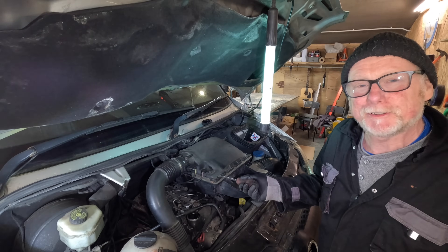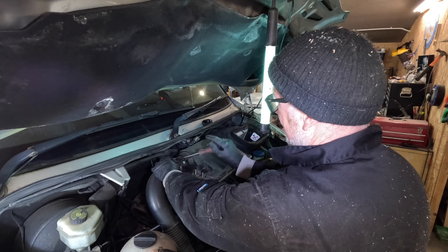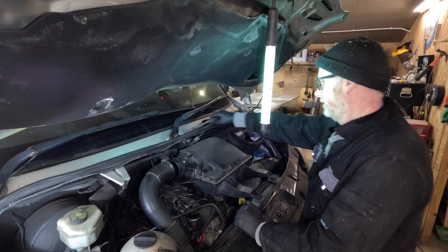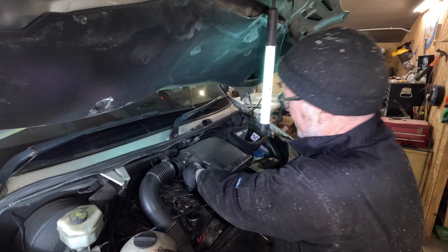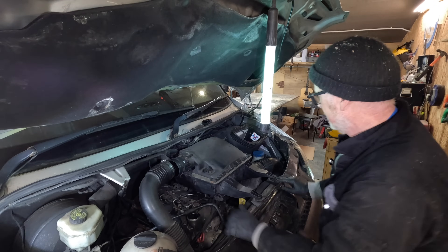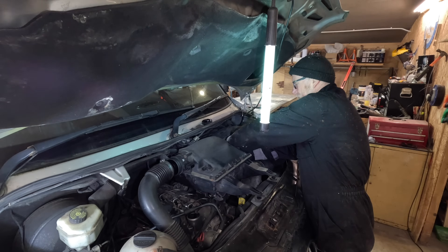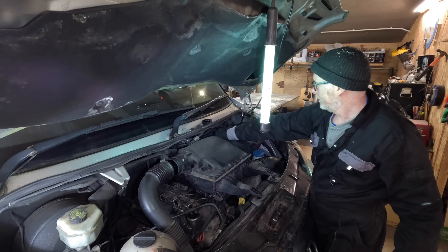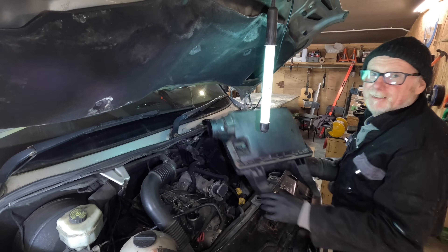Now to take the air box off a Sprinter, it's really simple - it's literally just one screw. That is the screw that holds this jubilee clip on there. These clips you push, pinch, push, then pull. Just lift it up and take off the jump lead extender - this is in case you're ever unlucky enough to get a flat battery, that's how you can jump start the van. Tuck that away to one side. That's your air box off.